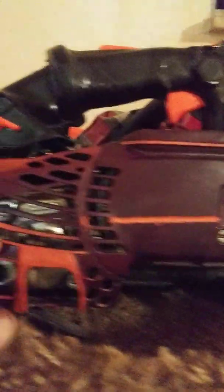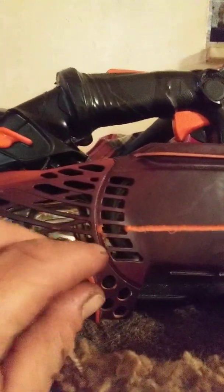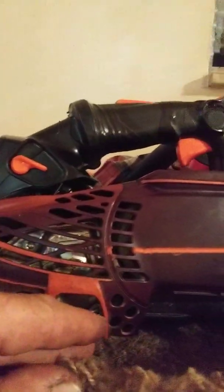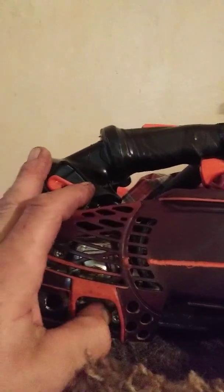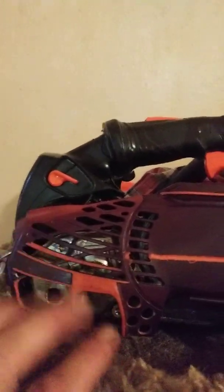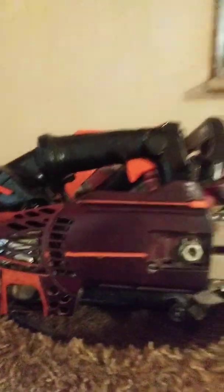Because the muffler's third mounting screw is on a little peg coming off of the block, if you omit that gasket and use just the heat shield, it won't sit evenly. If you do that, run it for 30 seconds, turn it off, and take the muffler off — you'll see oil spray all over the heat shield because it's not sealing. A tight seal between the exhaust flange and the muffler internals closest to that flange is critical.